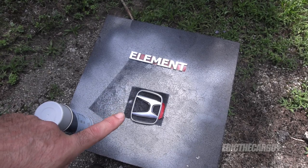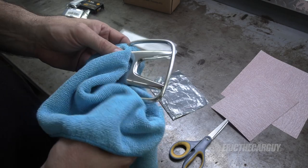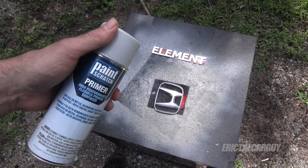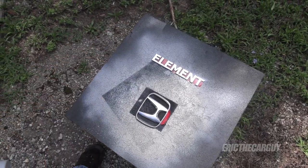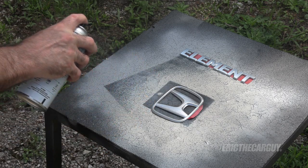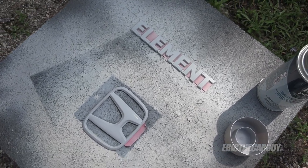So I just took a cloth, cleaned them off as best I could, and didn't touch them with my hands when I laid them down. Now I'm going to add some primer. When you add this, you don't need to run it on so thick — put it on in thin coats until you've got the proper coat. It's better to do a bunch of thin coats than one big coat with drips and runs. It's also nice to be doing this on a warm day — cold days paint doesn't stick as well. Let that coat dry, come back in a few minutes and repeat until we put on the finished coat.